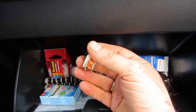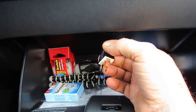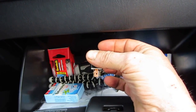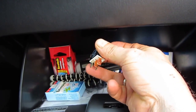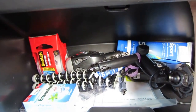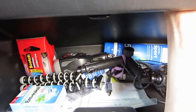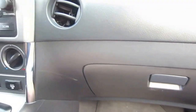When you put in the relay you actually don't need to take the glove compartment out — you can just do it by feel. Make sure the relay is facing the right way: two contacts in the back and one facing you, that's how it goes in. Make sure it's in the far right slot. Push it down firmly so it makes contact and now it should work.